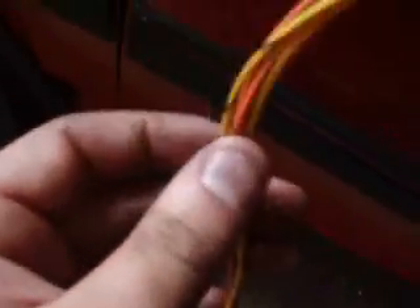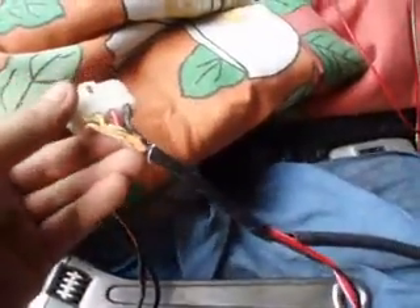Now this main wire plug here — those are injector wires. There are four of them because it is a four-cylinder and I have it hanging there so I can sort it out. Lastly there are three wires: basically one for the O2 sensor and two others that I don't need, so they are out of the way. Now this is the main plug which I am going to connect to the motor coil plug.